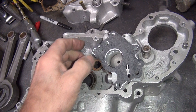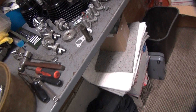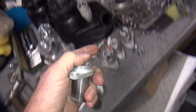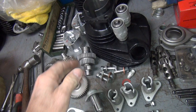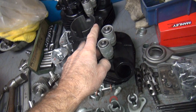I know one of the tricks is on the lifter blocks in the later motor — they have a hole in these that goes into the crankcase. So the crankcase pressure actually lubes the top of your lifter and bypasses. Right now the valves get lubricated by going through the lifter — whatever splashes past the lifter gets on the valve, otherwise it gets nothing. So in the later blocks they put an oil galley in here, kind of bypasses it coming from the crankcase side. They were playing around with this stuff on the K models — they're getting more oil to your valve train. In the real world, this thing doesn't need hardly any oil at all to it. That's why I don't put valve seals on these flatheads, because whatever gets there it's highly, highly regulated already. Over-oiling is not an issue.